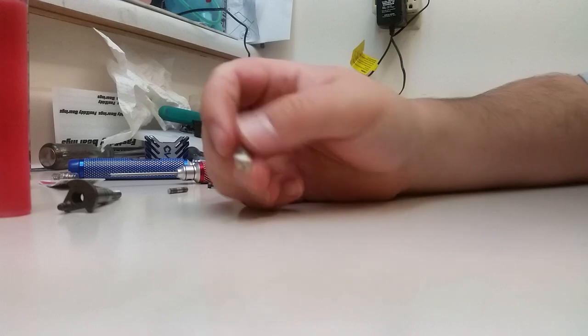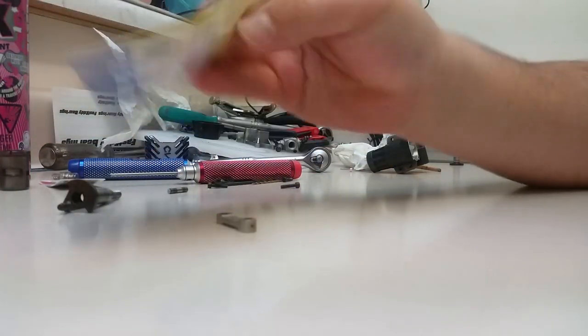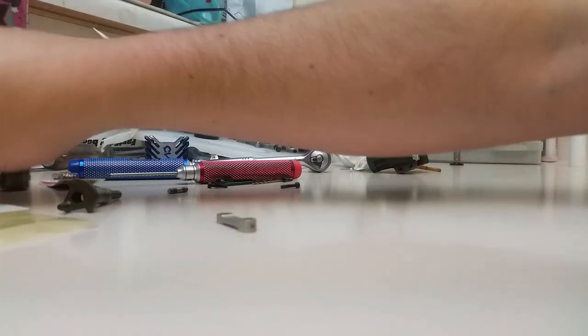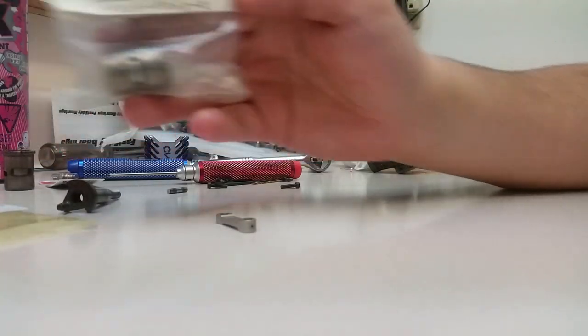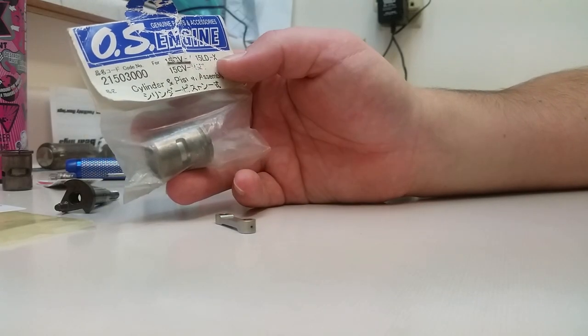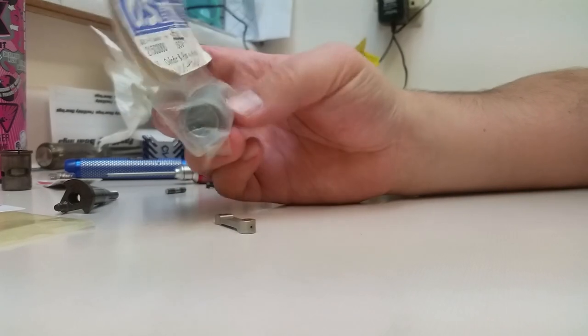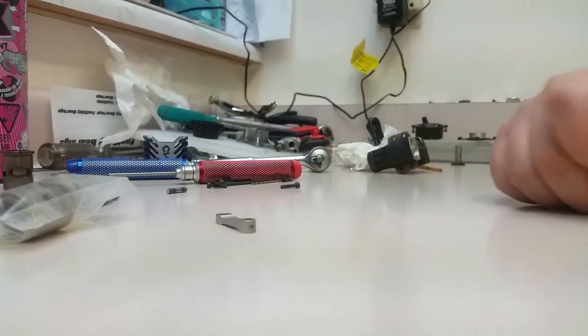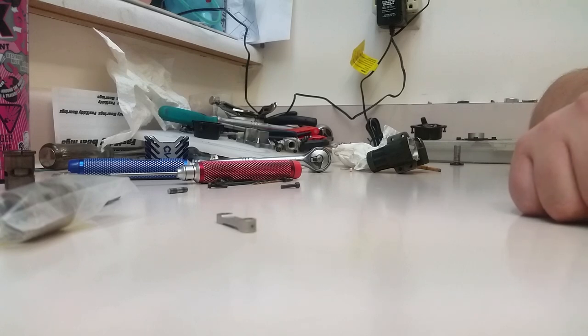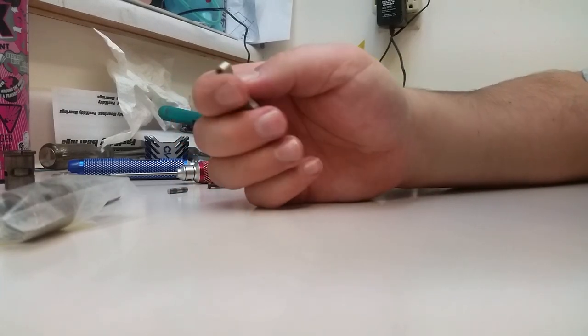So here's our connecting rod. It's in good shape. I also have a new wrist pin I was able to find from Hungary. I apologize, it's been a long day. And we have a new 15LDX15CV piston and sleeve here, which also came from Hungary. They were the last ones I could find. But here's our connecting rod, and we're going to look at it really quick.